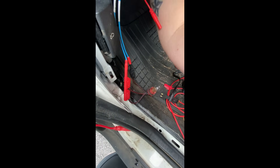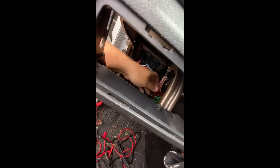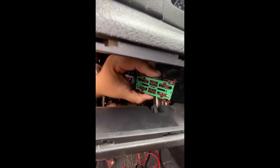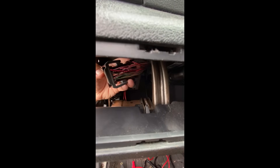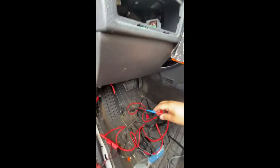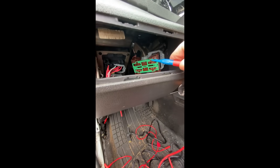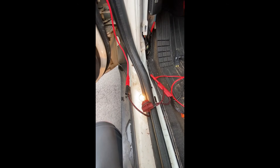The light went out. Now the next step is to break it down by each circuit — we had pins 6, 7, and 19. I'm going to touch each pin. I touch pin 6 and my light lights back up, so that means pin 6 is my short to ground.